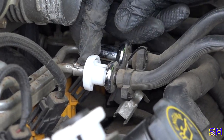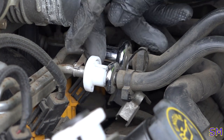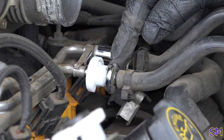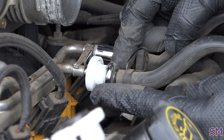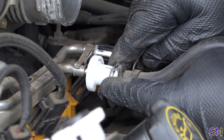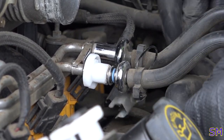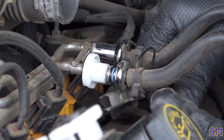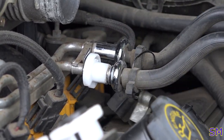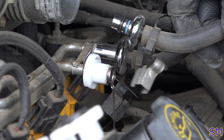I know there's a lot of videos out on this, but find the right size, push it into the inside collar like that. That relieves the spring tension. And grab this big metal piece and it should disconnect. This one's been on here a little while. Can't quite get up because I got a PCV hose here that's stuck. There you go. Remove your PCV hose from your valve cover first. Now you can undo it. There we go.